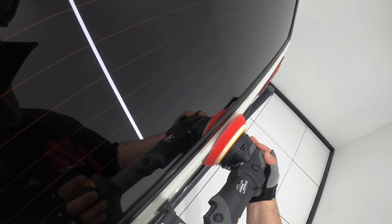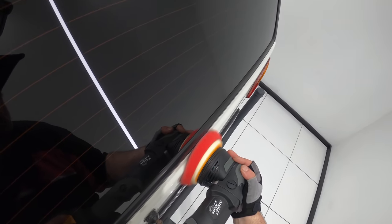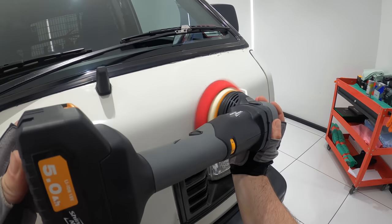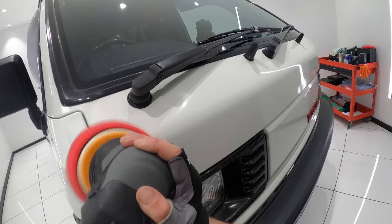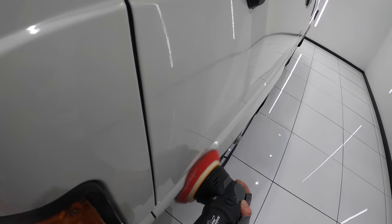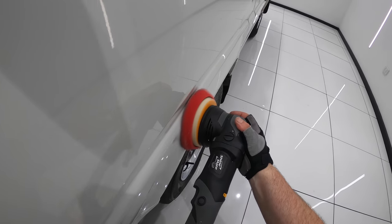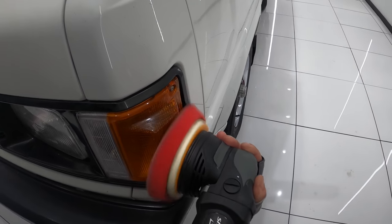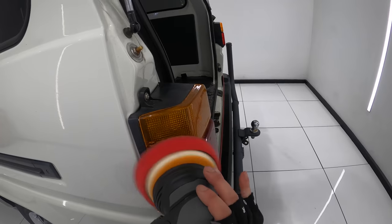So overall, just like trying to repair or revive the look of a ceramic coating where you really don't want to use a traditional compound or polish as it's going to compromise the coating, I found that the same can apply to older, thin and sensitive paints that just aren't appropriate or safe to polish with abrasives. Additionally, you can certainly also use Essence Plus to polish lights and gloss plastic trims, and I've found it to be quite forgiving if you do get it on other plastics or rubbers, as it doesn't tend to usually stain them and seems to wipe off without too much drama, unlike most true compounds and polishes, which again saves time in not having to mask the vehicle or deal with time-consuming product removal.